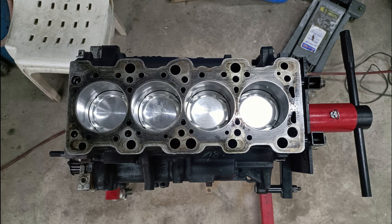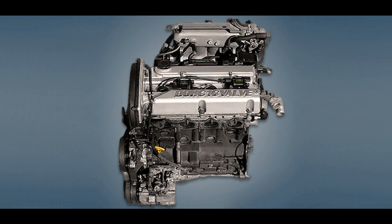For our purpose — just using it on the street, maybe racing it once or twice in short duration events — piston oil squirters are not that necessary. We're also running forged pistons, so the hope is the piston is more durable and less susceptible to that failure mode. Installing oil squirters also entails additional cost at the machine shop, so we decided not to put them back in. The Series 2 G4JP doesn't come with oil squirters either, so we did not bring them into our engine package.